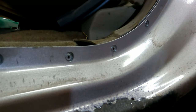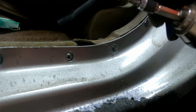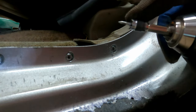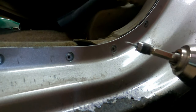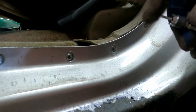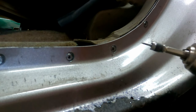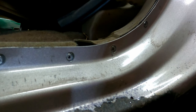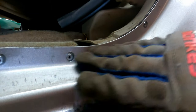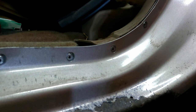So that's it as far as drilling out spot welds — it's pretty simple. Just get yourself one of these spot weld removal tools. It's double-sided, so when this side gets dull you can flip it around, and there's at least a dozen of them. I use a small drill bit to make a pilot hole to center up this spring-loaded center punch. Don't be afraid, it's easy to do. Once you get the panel off, you'll grind all that stuff flat, drill holes in your new panel, re-weld them, and you're good to go.